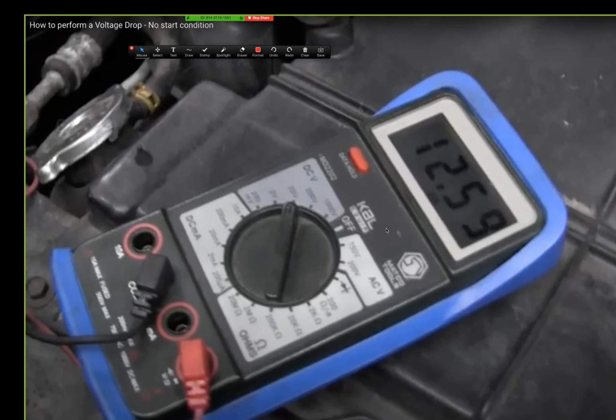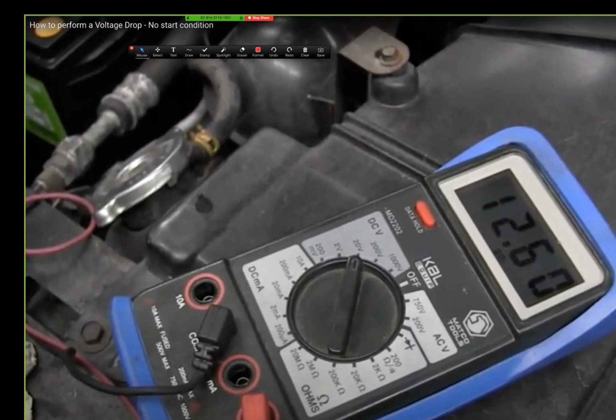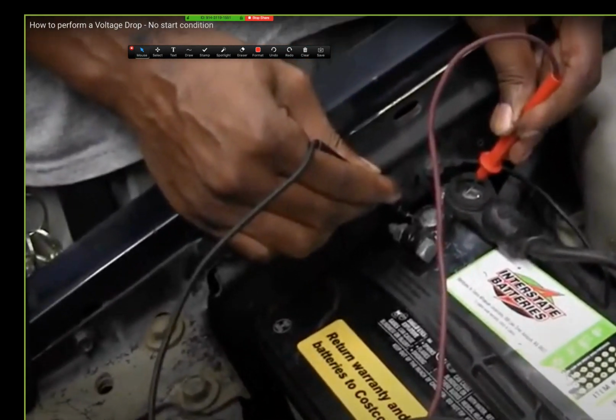In this case, it's a two-piece cable. I'm gonna show you when we fix it. It's actually a two-piece cable. That two-piece cable they got from AutoZone had too much corrosion between it. And that corrosion, I needed that voltage to overcome that resistance. That's cranking. It's right here. This voltage, this resistance right here is taking out 12 volts.